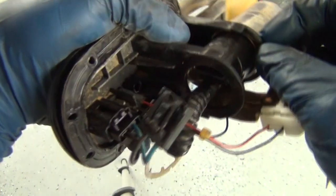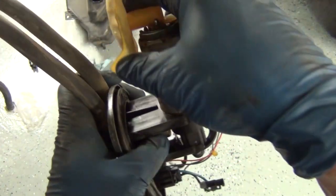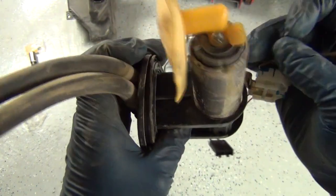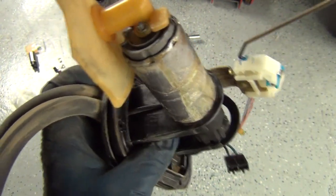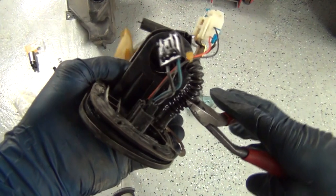Be careful - you don't want to break these; you'll need them when you go to put in the new one. Make sure you look at your new strainer setup: the new strainer's not going to be like the old one, it's going to be different and you'll have to fold it. That's fine, but the little tab that it's retained on - watch that and make sure you get your right orientation. Also, this fuel hose is toast.